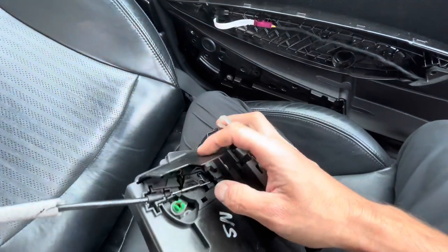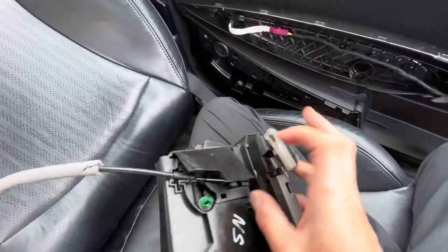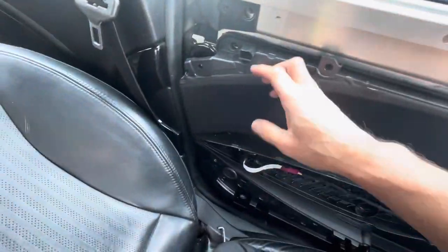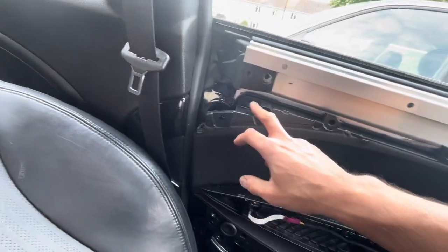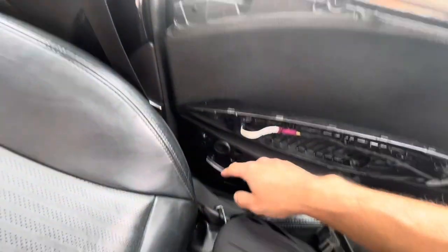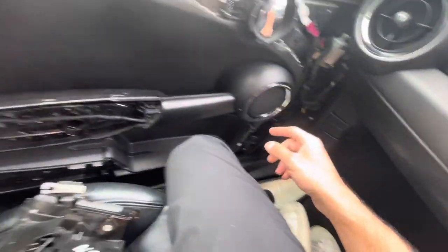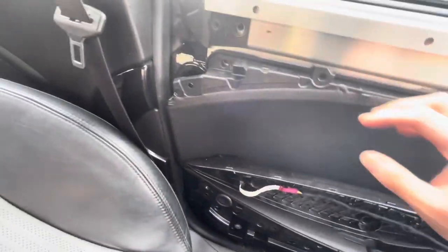So to do that when you're in the car — let's lock it again. What you're looking at here is you have to try and get parts of the door card off. I think there's a few bolts — one down here, one down here, I think there was one down here, probably one behind. Just try and get as many bolts as you can off and just wedge this open.